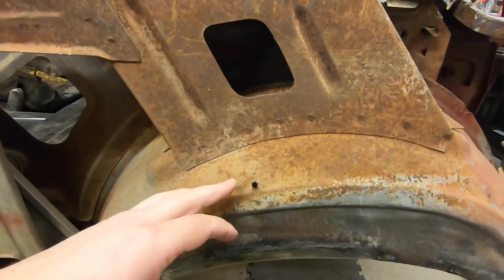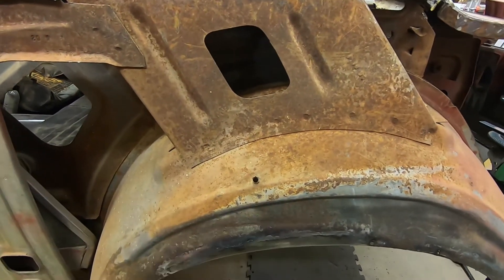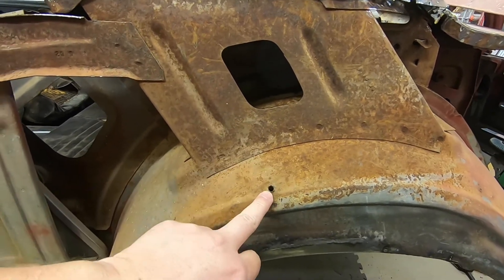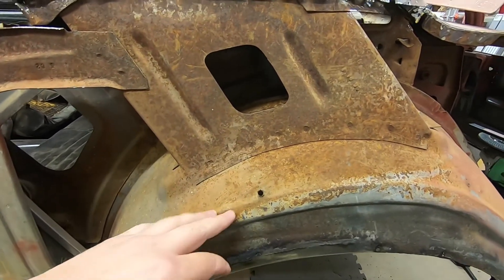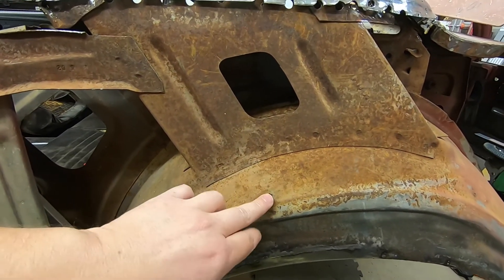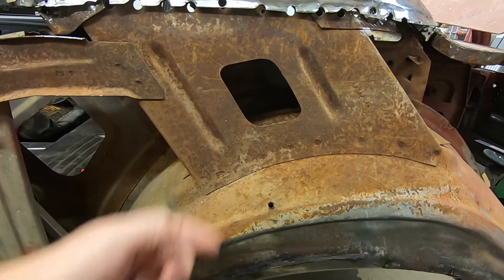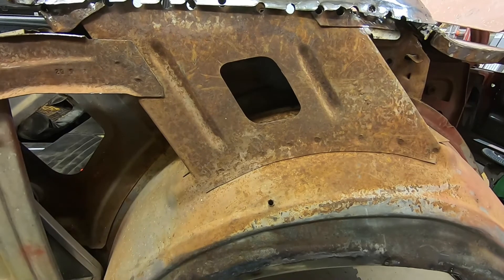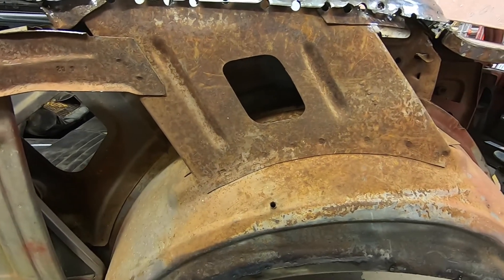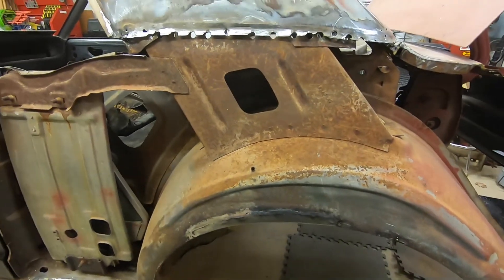That's why this rusted out — the water came in up here. This is almost a quarter-inch hole actually. So what I'll do is just leave this piece in place — I will not grind that off. Leave it in place, gives you some meat. Just weld it up — I'll clean it from both sides, weld the hole up, smooth it off. It doesn't really matter. No biggie — it'll be fixed when I'm done.